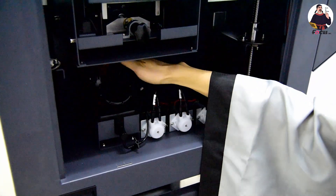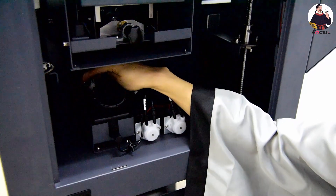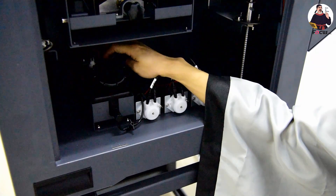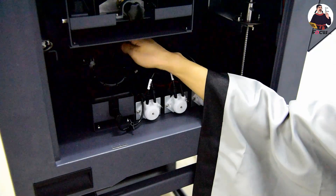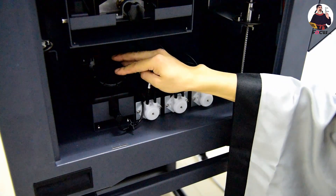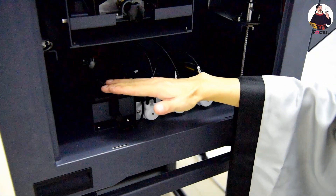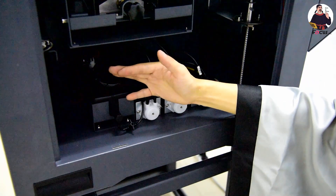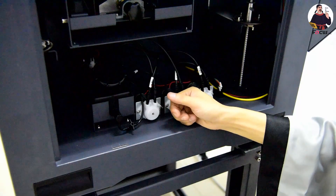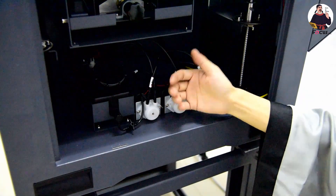There is a battery here which is for the alarm sensor at the top of the waste ink bottle. Pay attention — the button battery may have very little power and needs to be changed after one to two months. The alarm sensor will flash a light and make a long beeping sound when the waste ink bottle is full. Even so, release the waste ink every day — otherwise waste ink will flush back into the pump causing pump and capping problems.